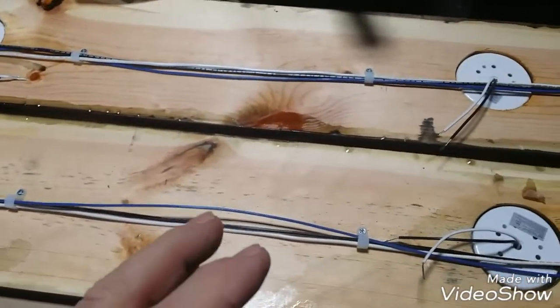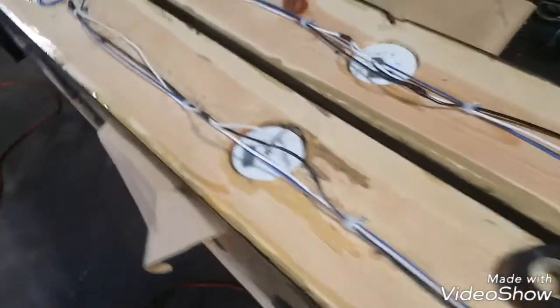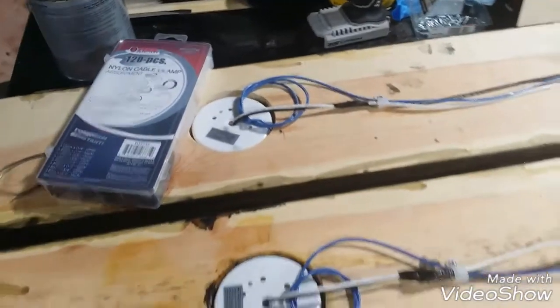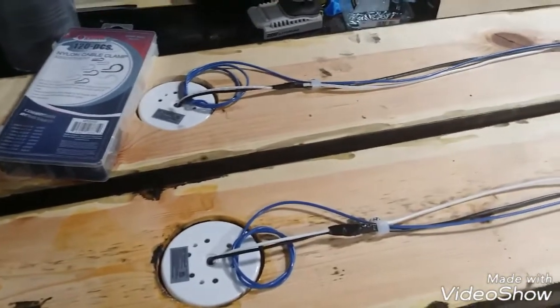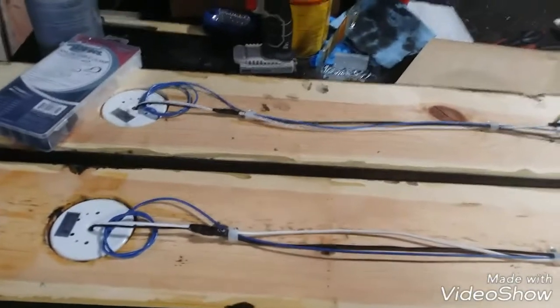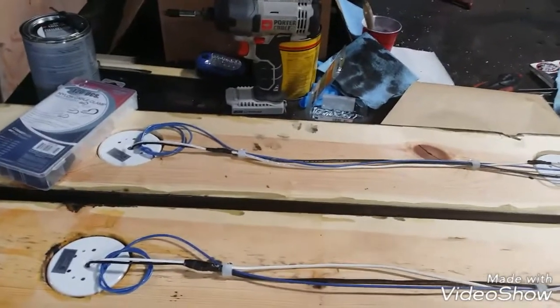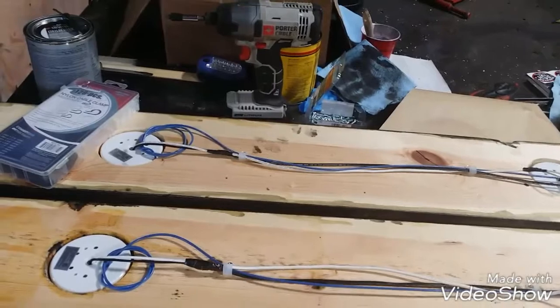And then I pulled what we'll call in the industry a switch leg, or a wire that comes hot when the switch is turned on, and that's going to wire to every one of these LED interior lights. And then curled up at the end is another switch leg, another wire that will come hot when another switch yet to be determined is turned on. So there will be some colored, I want ultraviolet, blue, purple, accent lights attached to this board. In some means it might be a rope light attached to the bottom. I'm just not sure what that is.